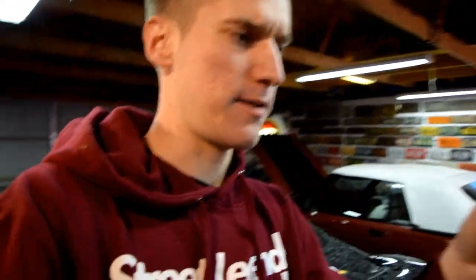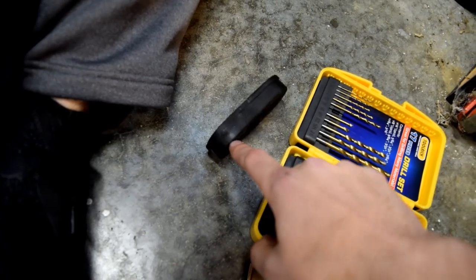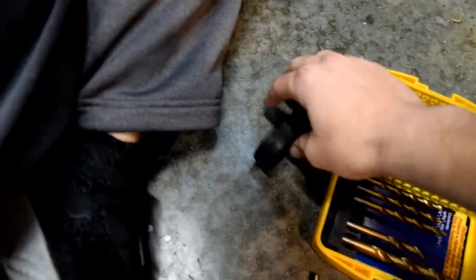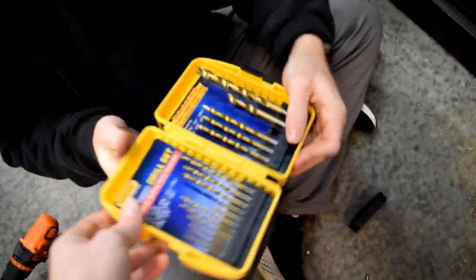This is not the permanent exhaust I want in my car, but right now I gotta make something work. First we're gonna cut the zip ties off and then line up this one with where the two little hangers meet. Then we're gonna drill this and hopefully debunkify this exhaust. It's a dark one. I can't even see it. We need to cut right here and then mount this bad boy in there. Our goal is to put a little hole about right here, that way the hanger can go this way, because this has both hangers going the same direction and they're actually perpendicular to each other.